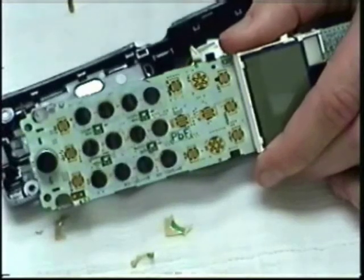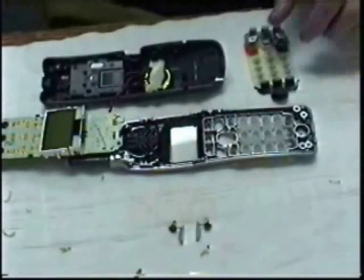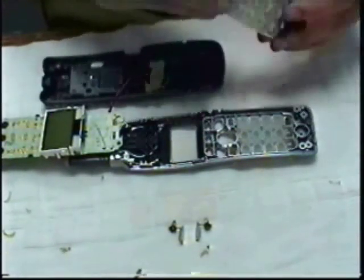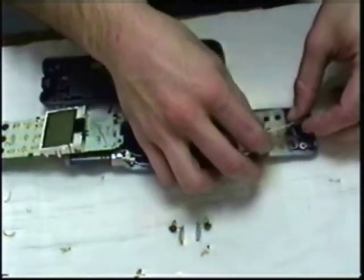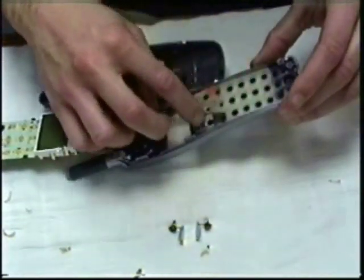And that's it. Reassemble your cordless phone, making sure your tone pad, rubber headset plug, and if applicable, all other buttons are in place. Carefully flip the circuit board back over and fasten the antenna screw. Next, return your charging contacts to their correct places. This will be much easier to do if you remember in which order you remove them.